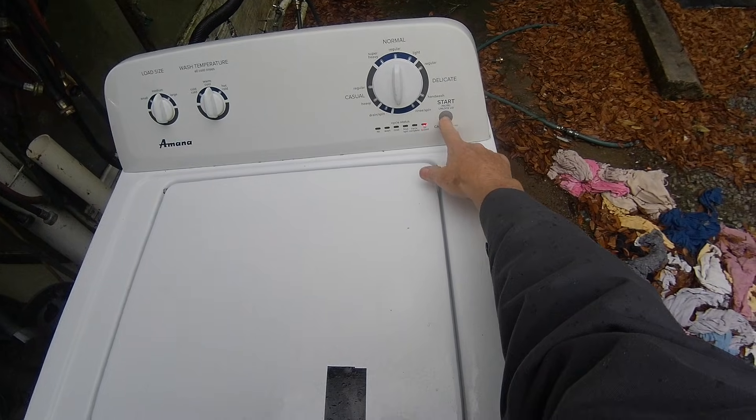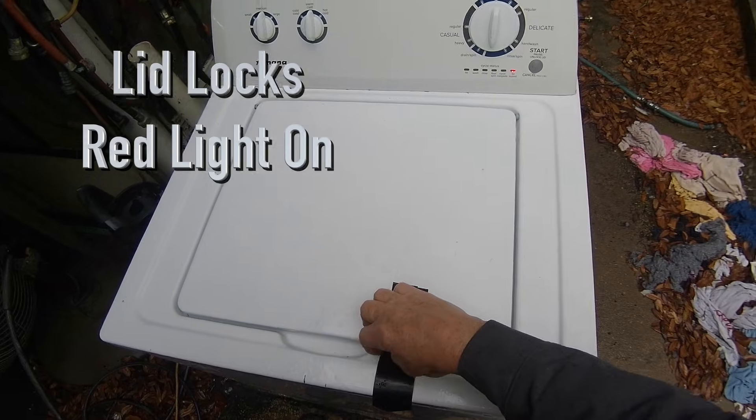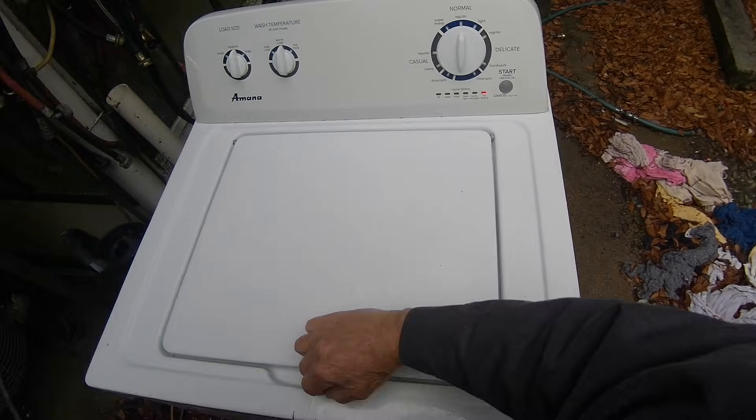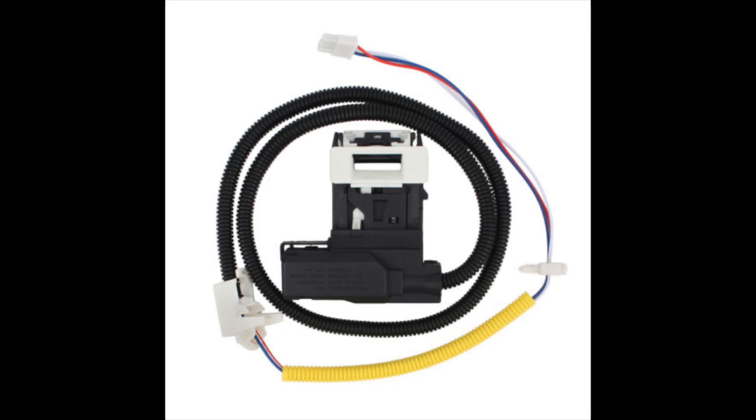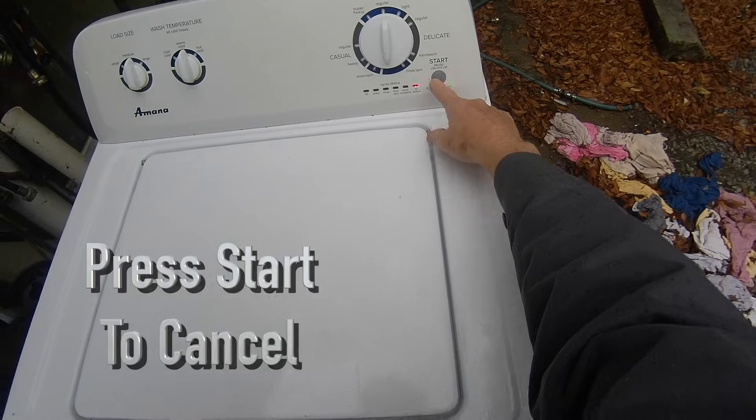The first system to test is the lid lock. With all the LEDs off, press the start button — the lid should lock and the red LED all the way to the right should illuminate. If it doesn't and you see all the LEDs flashing momentarily, the lid lock has failed. Or it may illuminate but start clicking on and off without any input from you. In either case, the lid lock needs to be replaced. To cancel the lid lock test, press the start button once again and you should return to the state where all the LEDs are off.